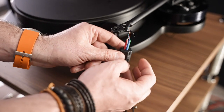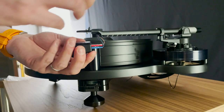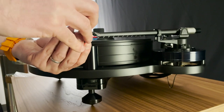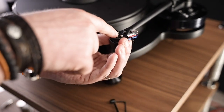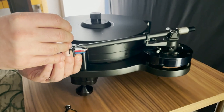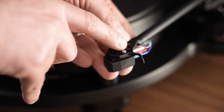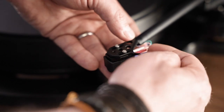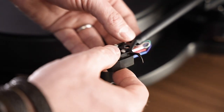Once those connectors are all pushed on, use the two screws provided and the Allen key to fit the cartridge onto the tone arm head shell. The starting position is with the two screws in the centre of each slot in the head shell around the centre hole, so the cartridge is fairly square in the head shell. Dress the wires so they make a nice little loop and aren't hanging down where they can touch the vinyl when playing. We'll align the cartridge later on — that's pretty much where you want it for now.